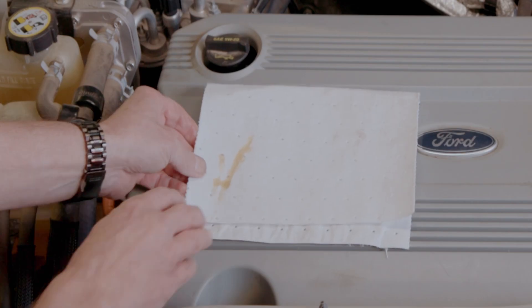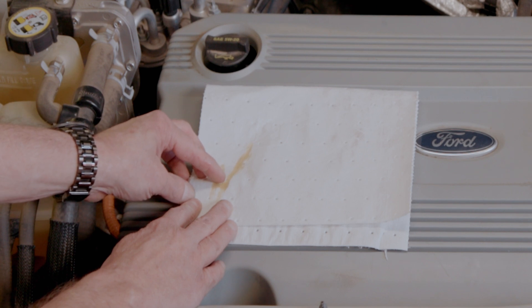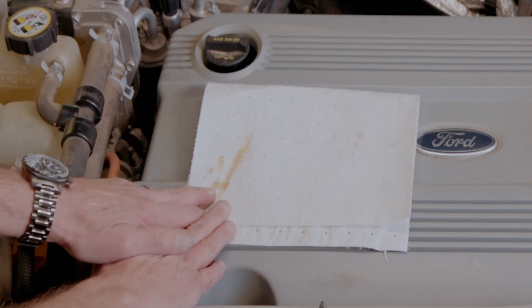When it comes to the oil, one thing I can look at is the color. Is it a nice amber color as we see here, or is it a brown or black, indicating that the oil needs to be changed? Thanks for joining us — check out other videos from the Automotive, Diesel and Electric Vehicle Programs here at CNM.